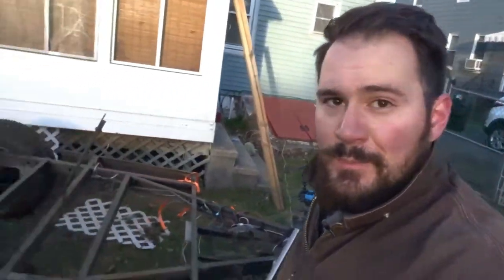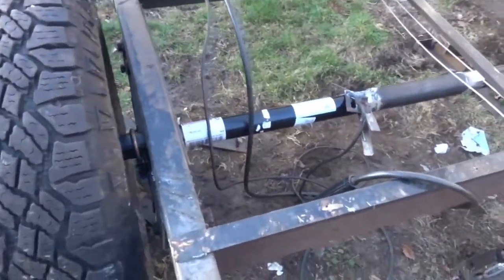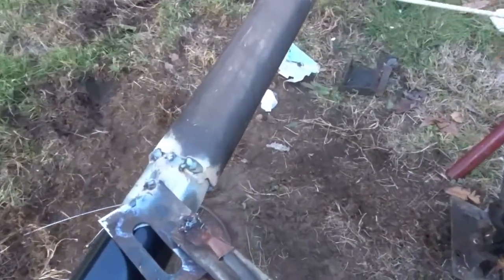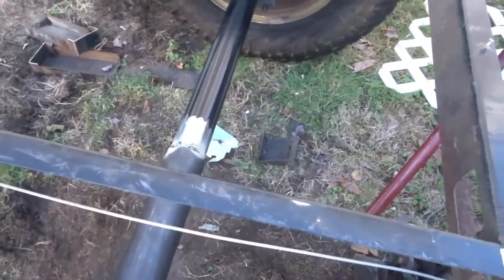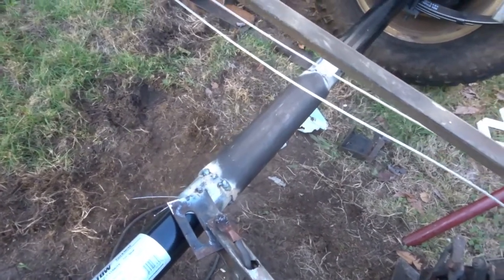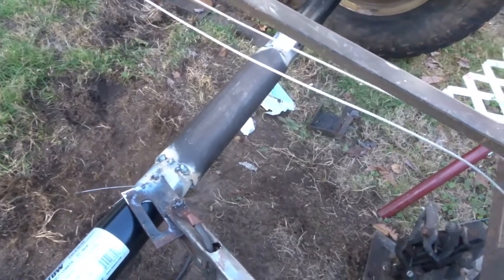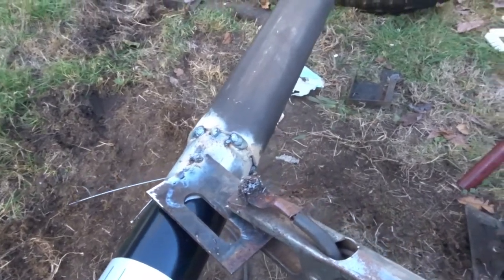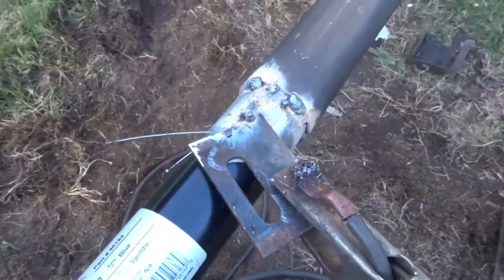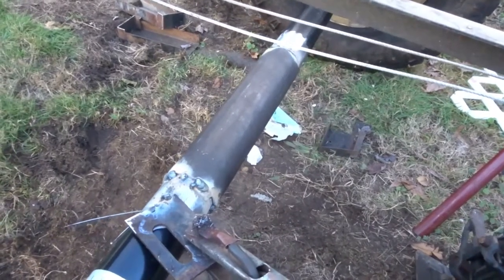The sun's going down, but I got something done. The tires are installed now. We have just enough space that I don't have to worry about it rubbing the frame. I got a few welds on this DOM tubing. I'm going to put some straight edges on the tires, kind of align the thing, crank on this if I have to, and then finish welding it at my dad's house. I didn't have a ground — I didn't have anywhere to actually hook my ground to — so I just welded this piece of scrap metal onto the bare steel. I had to do a lot of grinding to get this to fit properly inside the DOM tubing, but it fit like a glove when I was done.